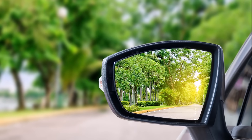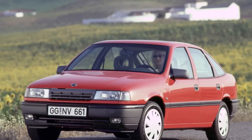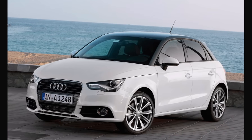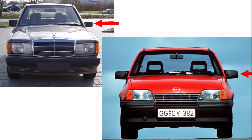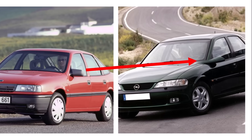Let's talk about a not so obvious but still interesting engineering topic today: mirror design. For the last 30 years, cars usually have two side mirrors which are exposed to the airflow, and because of that their shape and development changed a lot over the years. At first, these mirrors were being kept close to the car to reduce the frontal area. Then there were attempts to reduce the high pressure in front of it and to guide the air more gently around the mirror.